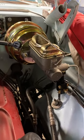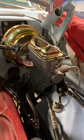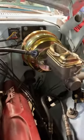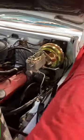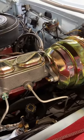And it's just good old wholesome hard work, front suspension work, nothing too serious. And with a poly 318, it should make copious amounts of vacuum, and the booster should work fine. So tomorrow we're going to get it on the ground. And if we get the brake pedal adjusted correctly, we'll probably take it out for a drive.